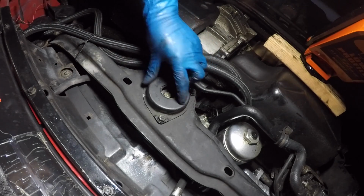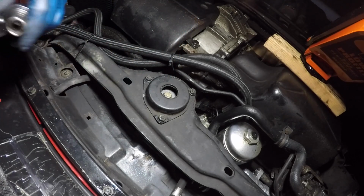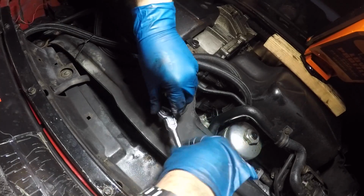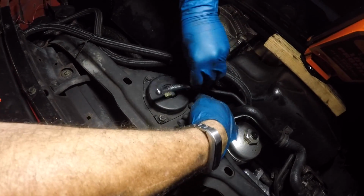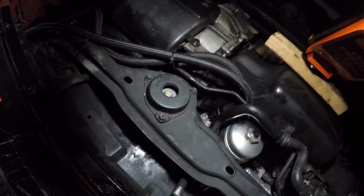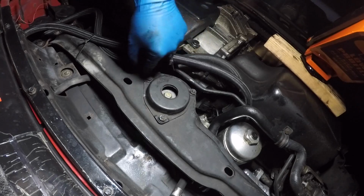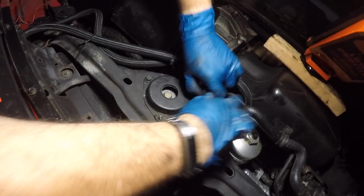So there's a big silver washer that goes over the motor mount, and then a longer bolt, and that gets tightened to 44 foot-pounds. If you try to use the factory stuff, you will be in for a lot of frustration, because the factory stuff is not going to work. The bolt is not long enough to go through the new motor mount. So just be aware of that. And then this little protective cover, you don't need to use Kung Fu Voodoo Monkey Death Grip. They just get tightened enough that they're not going to work themselves loose. And that's it. 2 hours later.